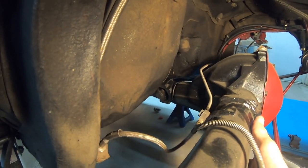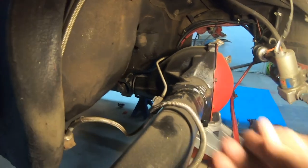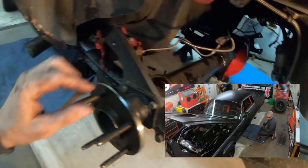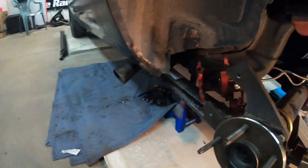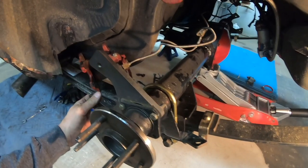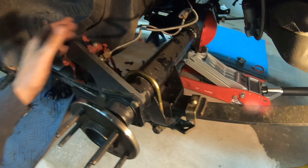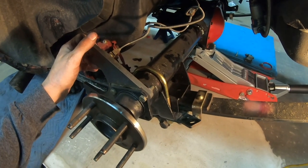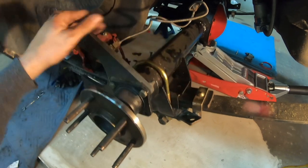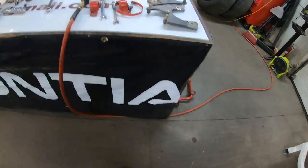I've got a T-fitting with a half-inch nut to take off, and then I'm going to take off the four 7/16 driveshaft bolts. I got the brake lines loose, got the driveshaft off. The next thing is to get this disc brake bracket off — it has three bolts. I need to take it off and put it on the new rear end, so while the rear end is still bolted to the spring I'll go ahead and take those off.